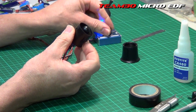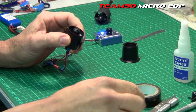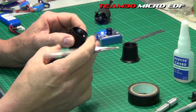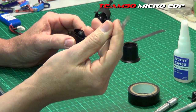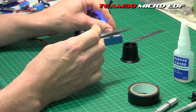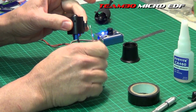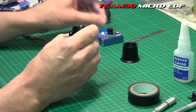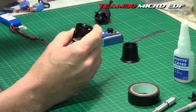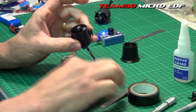Now I can feel the shaking — you can feel the vibration. Here's another thing you can do: if you've got big hands or you're not very sensitive on the fingertips, if you hold something like a pair of tweezers — just imagine this is like a tuning fork — if you hold that against the fan gently, it will amplify the vibrations and you can feel it much, much better. I can feel this shaking like crazy against my fingertip — it's giving me pins and needles type sensations. I can really feel it vibrate because you're using this to amplify the error.